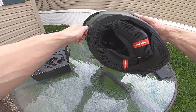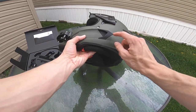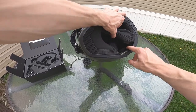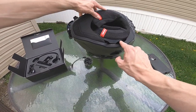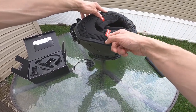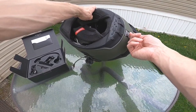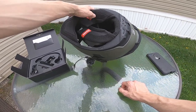You're going to have a wire that's already inside — make sure you pull that out. It might be taped in, so pull the tape off and pull that wire down. Then inside the helmet, your speakers are pretty much going to sit right where those black pieces are. Pop your cheek pads out and your speakers are going to sit in that area on either side. You can pick which side you want your microphone on — that's going to sit inside the cheek piece as well. Run those two wires in the back through a small hole to connect them to the Shockwave system.